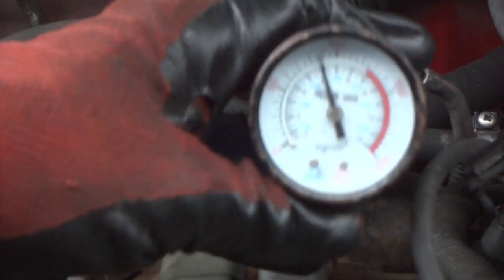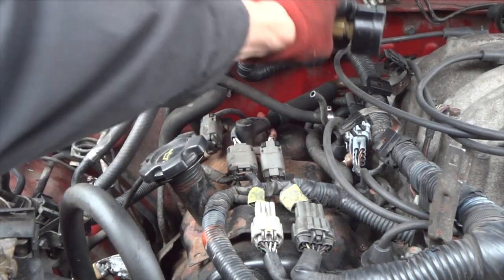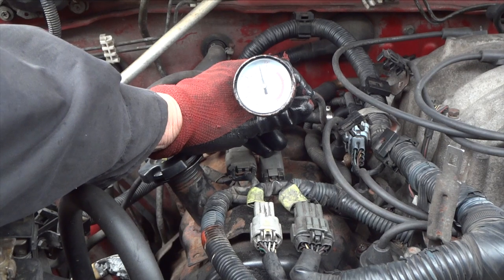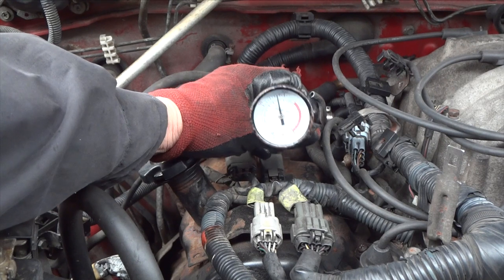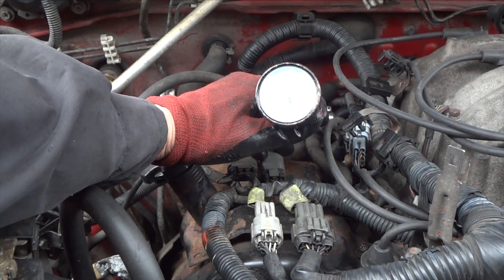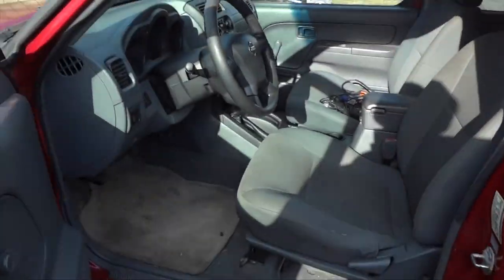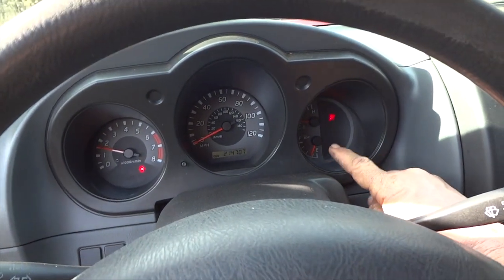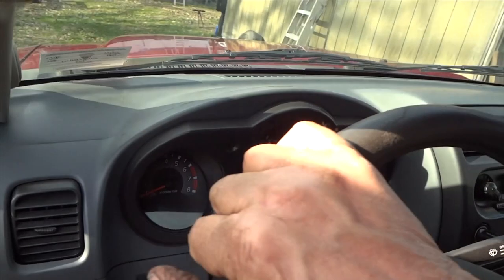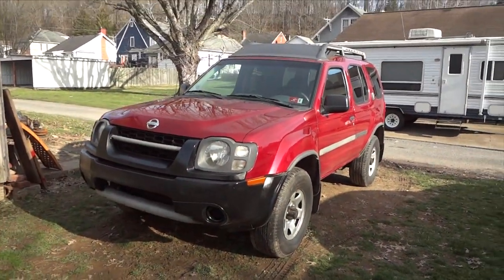We're still holding really good fuel pressure after about 20 minutes — great results. A side note: if you want to monitor fuel pressure while the engine runs, you could cut into the line, put a T-fitting, and run a line to your gauge. If pressure drops a lot after shutting off, you may have a bad fuel pressure regulator. This is one way to verify your fuel pump is working correctly. The gas gauge is working and we're done — hope the video helped, give a thumbs up, and I'll see you next time.